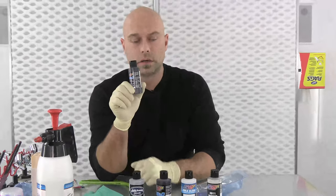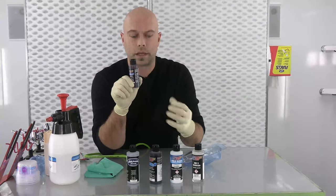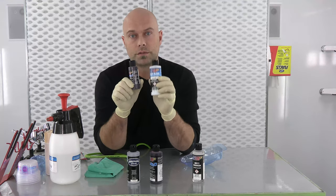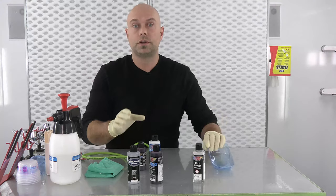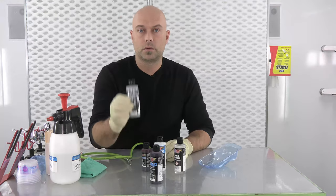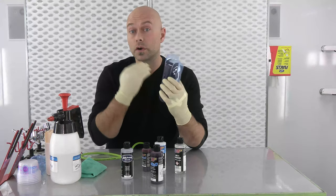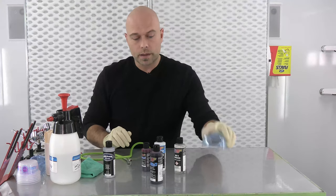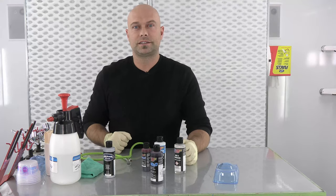When you're mixing, you have your candy which is your color, and then you need a carrier — something to add that candy to in order to make it spray. In all cases for any of our candies we recommend our 4050 — this is our UV LS Gloss 4050 — and this is a perfect product because it adheres extremely well to polycarbonate and it's the good carrier for that candy. We'll also talk about reducer, and at the very end we'll talk about the ground coat. Because we're painting in reverse, that's actually the last step.